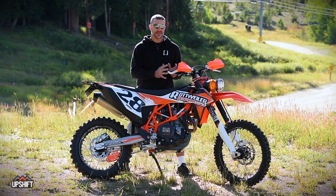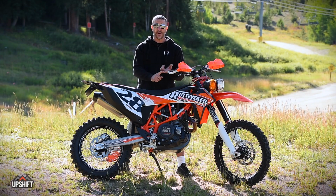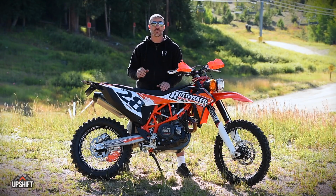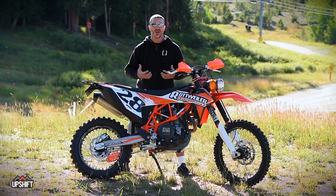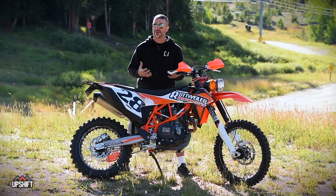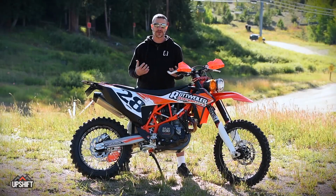So the front tire ended up being about 2 pounds lighter overall, so that's static weight, that's unsprung weight, and that's rotating mass. In the rear, we were able to pull 4 pounds out of the rear wheel by doing all of this. So the idea, again, is to get this thing performing and reacting as fast as it can and not have a big lumbering 690 that just isn't working, because these aren't known to work all that well, so we're going to do everything we can to get it to work properly.